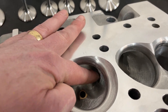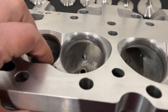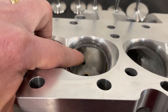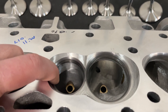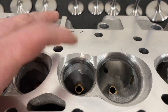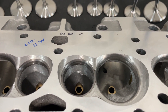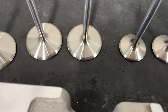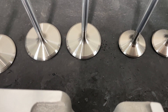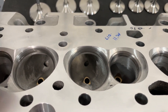I made the bowl bigger — that's why I broke through on the bolt hole right there — and made the throat bigger, widened the short side and laid it back more. This is about all you can get. On the exhaust side, all I did was blend in the exhaust. I hit the valve job, made it the throat size and blended it in. That's literally all. The valves got refaced because they're now 50-degree, so that did get changed too — those are new ones by the way.